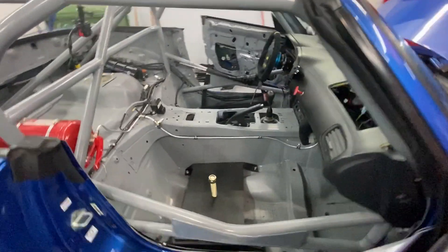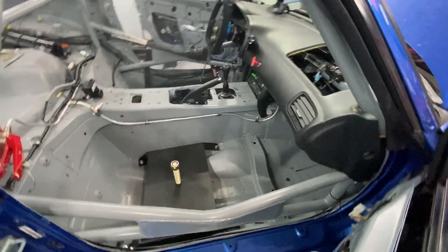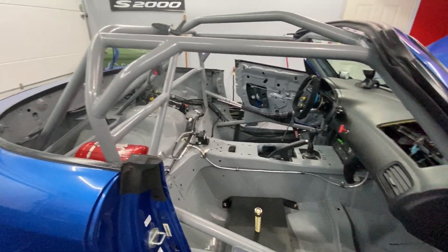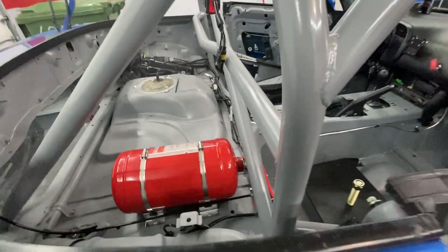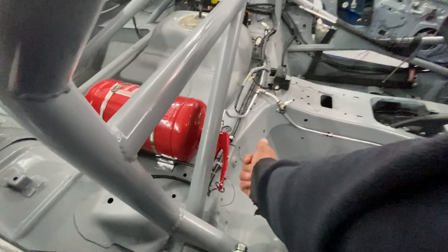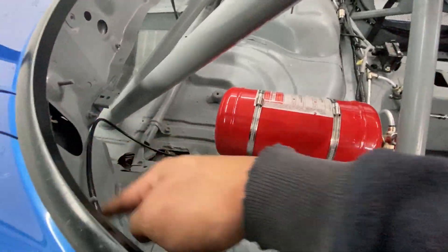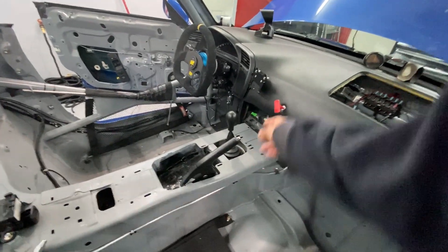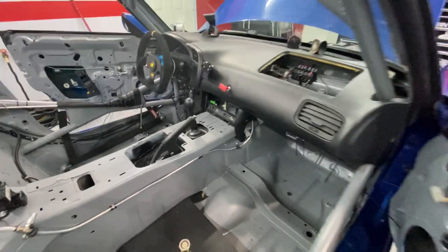I was thinking about using some of the real estate on the passenger side to do that, but I wanted to keep it available in case I want to put a passenger seat in the car. I ran five nozzles on this setup. You can obviously just grab it here and get it kicked on, and the way most people would do it in an emergency, this cord is wrapped through the dash and you just pull that lever. I put it there so I can reach it, and someone from the passenger side can also reach it — it's nice and easily accessible.